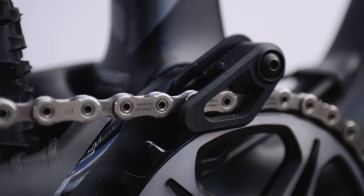The groupset is one-by Shimano XTR — top of the range, designed to be as light as possible. The cassette is absolutely massive. I've got a 34 or 36 front ring; I'll probably end up using the 36 since this bike is predominantly for racing. Crank length is 175mm, which is 5mm longer than I'm used to, but I've got my other crank set to switch to if needed. The bike has also come with a larger brake rotor on the front — I think it's 160 instead of 140 — so I'm going to give that a go for the extra stopping power.